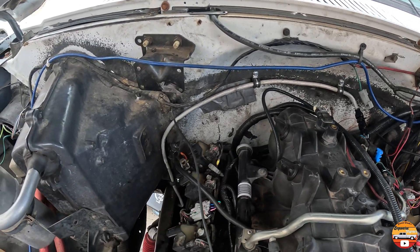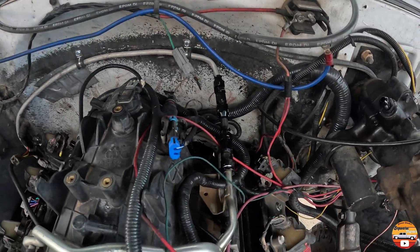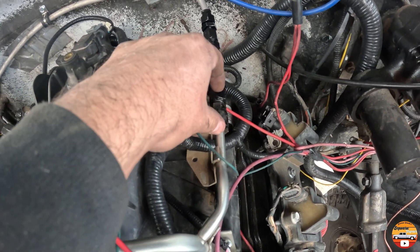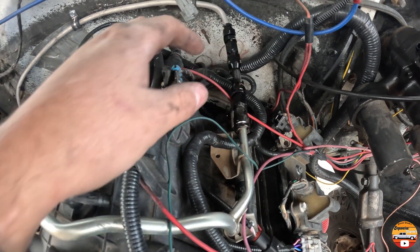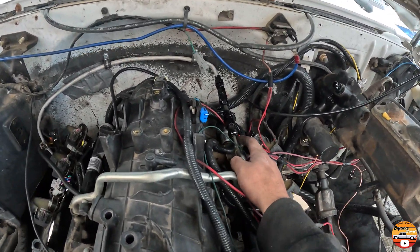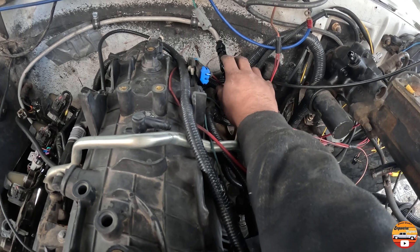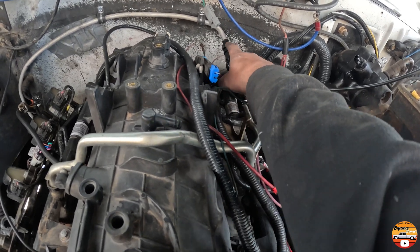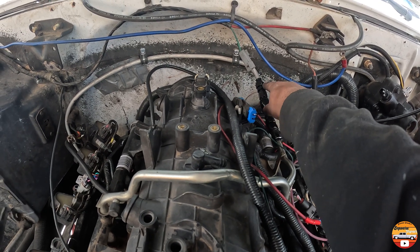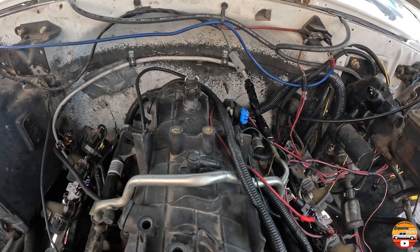We finished up our fuel line. Our line comes from down there, wraps over, it's secured in multiple places, and then goes to a little tiny AN line. That adapts to our 3/8 fuel line quick-disconnect adapter fitting - that link will also be in the description below. Basically that converts the GM proprietary fuel quick disconnect over to AN6. We have a little tiny maybe 2-inch AN line that then adapts to our tubing, and that goes to our AN6 to 3/8 hard line adapter. We have a nice clean setup now.